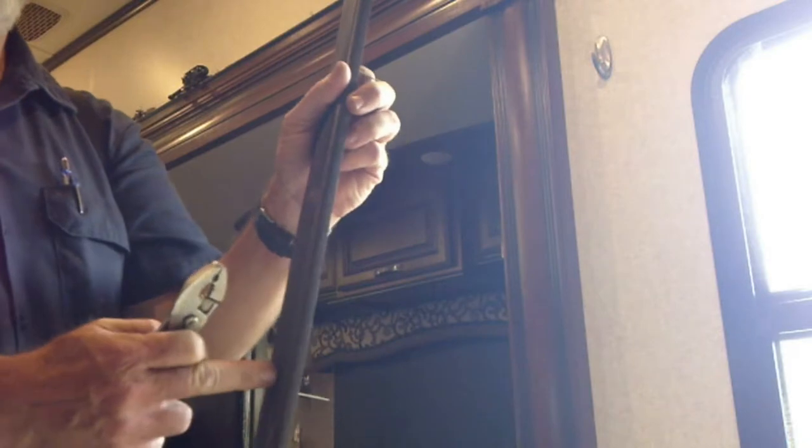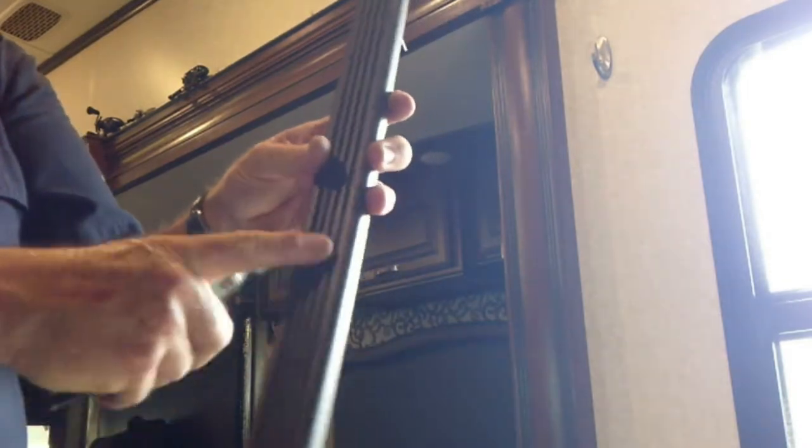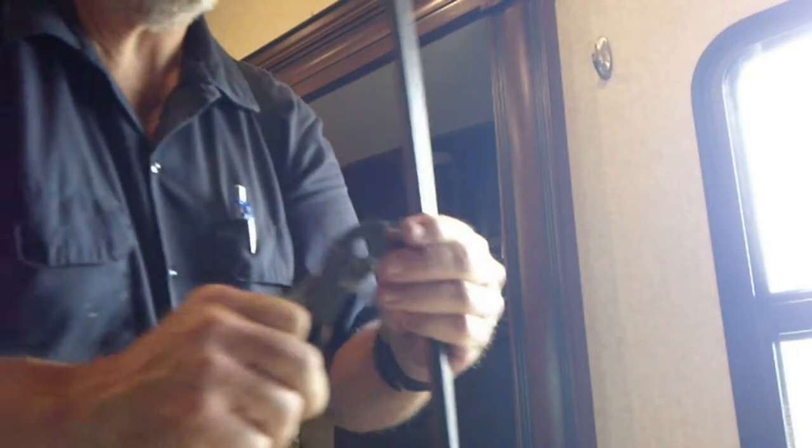Balance back. Oh, no. Nah. We gotta put the trim back first. So I'll get that all set up. Whenever you're dealing with this trim, do yourself a favor. We have to get these old brad nails out. Don't bring them out the front because you'll just end up with a big hole that you gotta cover up. Just get your pair of pliers, take them right out the back. When you do that, you've got no hole on the face to deal with. That tip right there is worth $1,000.